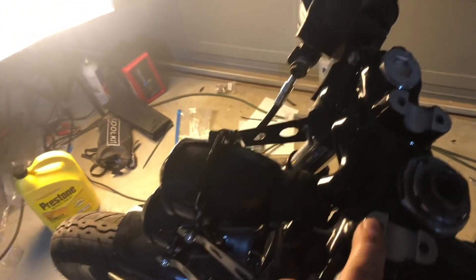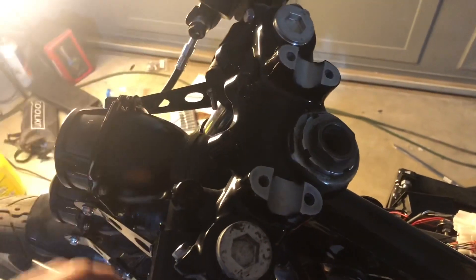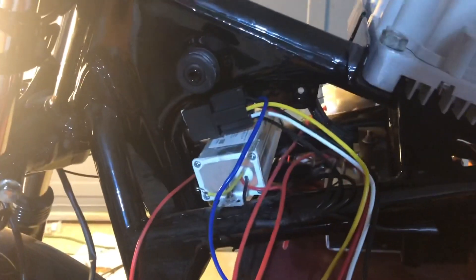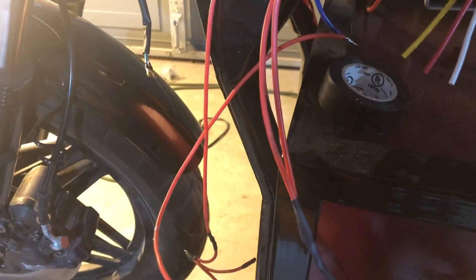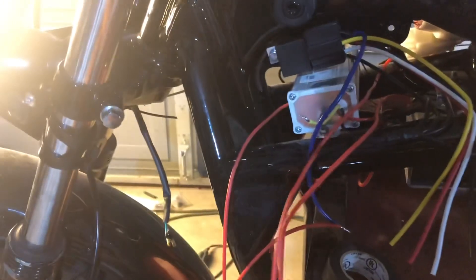We're also looking at how to attach this little cluster here. We're going to put a GPS unit just like the Chinese electric sport bike has on it. I've got the amp meter and the battery temperature meter that we're going to have above and below that. We're still looking for a place to connect the key - we got another actual key switch, which is my project right now. I've added a relay here and I'm setting it up. Previously everything was just running through this switch, and we didn't have a lot of power being pulled for the headlights yet.